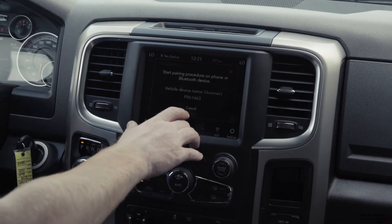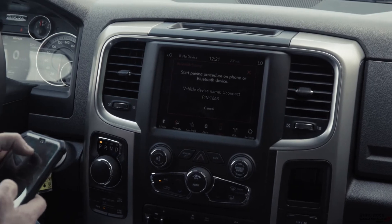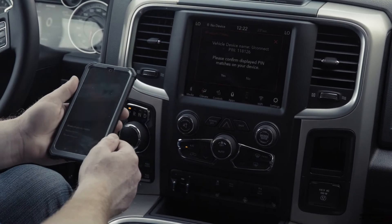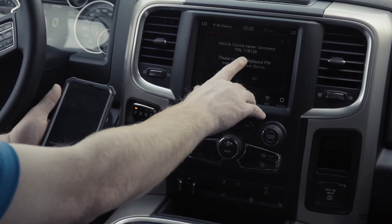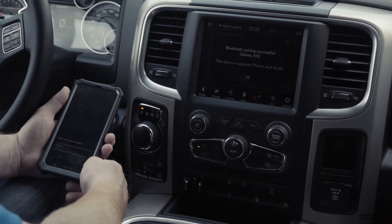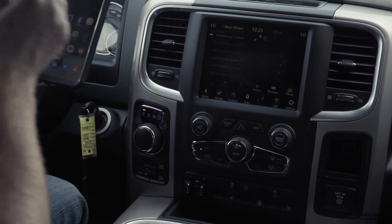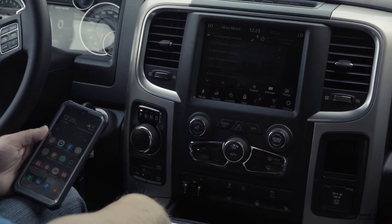There's no phone connected. You now want to connect your phone by going into your personal Bluetooth, and it will come up with a search. Pressing the button will then initiate the connection. You have to follow the numbers on your phone — 118126 matches the screen. Select yes and select okay. I have now successfully paired my phone. By following the instructions on my phone, I can also allow it to have all of my contacts, and everything in my phone will be allowed through to complete the syncing initiation.